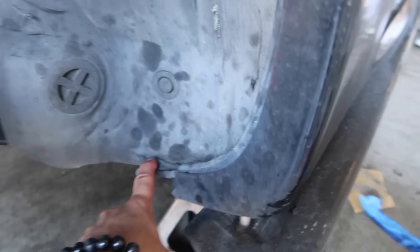Eclipses — you want to look at the strut towers. In Southern California we face no rust issues, but in the eastern states they do get a lot of strut tower rust. It's very common to see in Eclipses. Also, DSMs tend to rust a lot in the rocker panels. It's super easy to tell, so when you're out there looking for one, just make sure you check these points and make sure they're not rusting out.